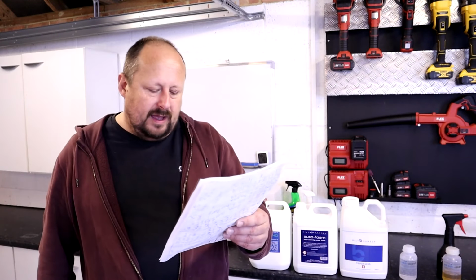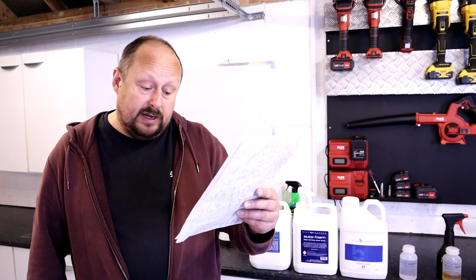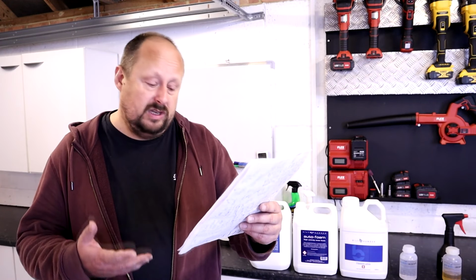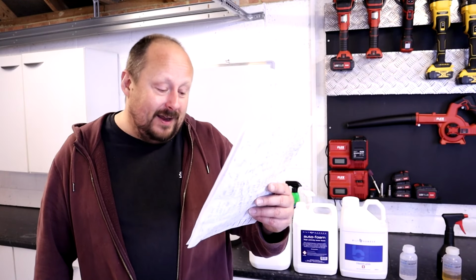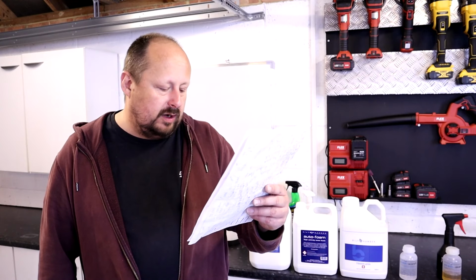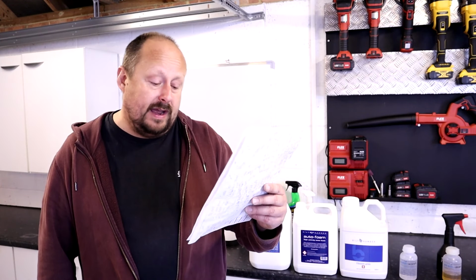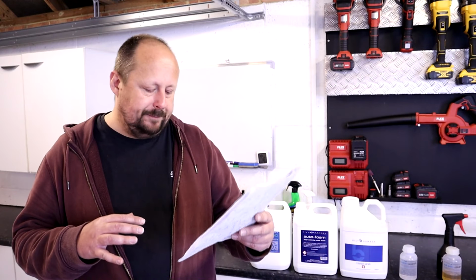Now I've got a bit of text from Bilt Hamber here on Surfex HD. Surfex HD can also be used as a pre-wash, and it's a capable cleaner in this way for removing oily road films, because it's a good degreaser. Its powerful degreasing ability makes it perfect for underbody and chassis cleaning. At dilute concentration, it will clean hard surfaces, upholstery and carpets too. So you can use this on the inside of cars. We'll talk about concentrations in a second.